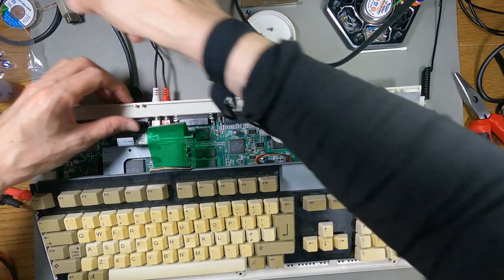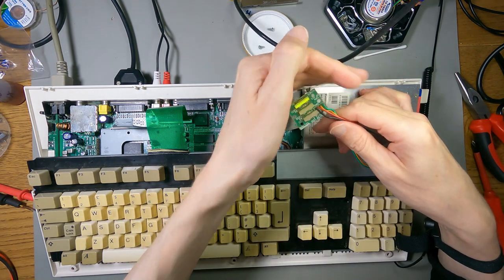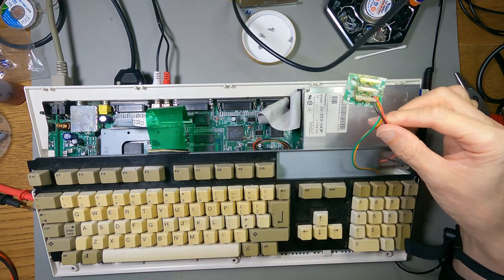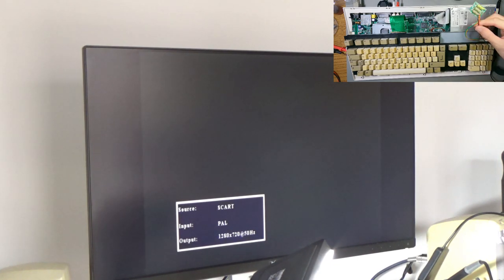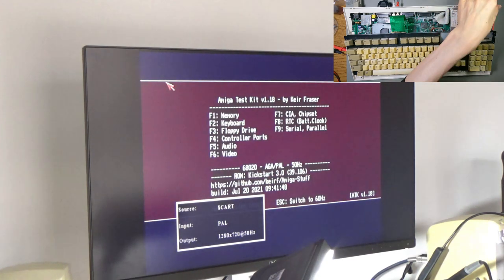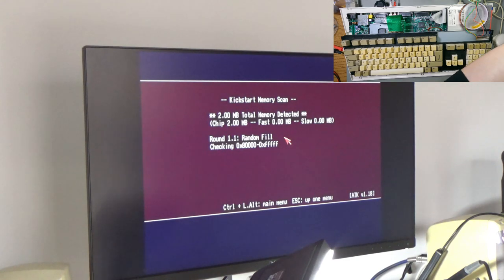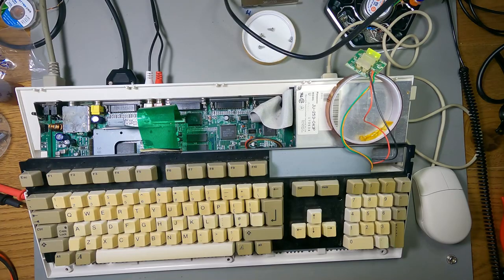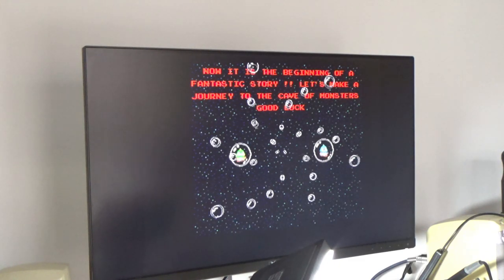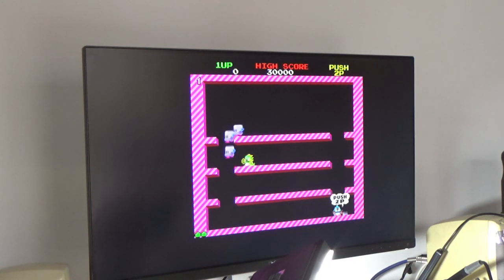Let's give ourselves a boot test and make sure I haven't broken anything in the reassembly operation. It's been a long time since this thing's been back together. Let's put the test kit disk in and see if we get any lights — or is it going to blow up? We've got a light! That's a relief. I need to make sure this doesn't short out on anything. Oh, floppy drive light's on. Right, let's do a quick memory test — just make sure it's not broken. It takes a lot longer on this because we've got two megabytes. Let's try some Tiny Bobble.